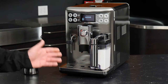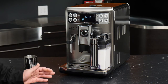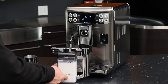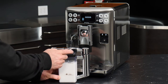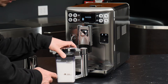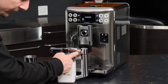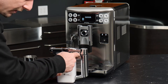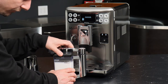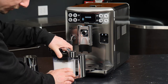To start things off we'll take a look at the auto frothing carafe on the Babila. I've got it locked into the machine but I'll show you how it comes out. We have the bottom carafe here which has our min and max fill lines, the top assembly, and then the frothing arm. There are tabs here — give a little squeeze to lift the top part off — but on the arm there's a little clip that locks the top of the arm in place. If you ever want to take the top off, swing that out and you can lift the top of the carafe off.